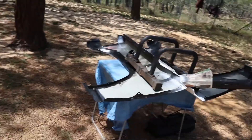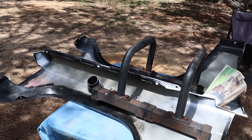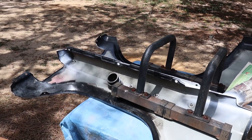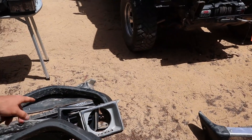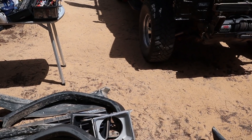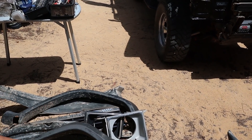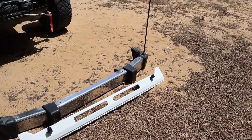I've been working on the inside of the wing, treating any rust and putting a layer of paint around the edge to stop the arches from rusting. There are all the trims, arch liners, the front grill, headlight and headlamp surrounds, bumper and the centrepiece which I also painted yesterday. We were painting the outside of the wings too — I'll show you around those when they're back on. Let's crack on.